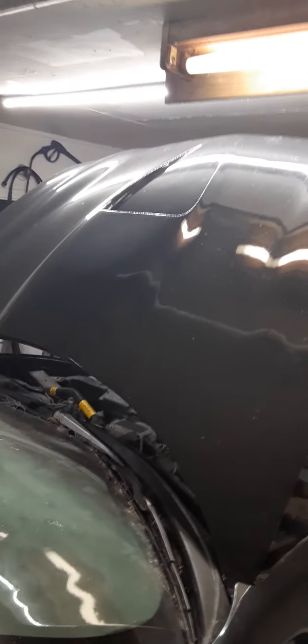I got another rear end to put in it. I think I'm going to put 3.42 gears in — I had 3.73s in my other one which I really liked — but I'm on the edge between 3.42 and just going with 4.10s. I'm not really looking for top speed anymore, it's more about quickness. Plus there's so much sketchy stuff that can happen with such an old car going 140-150 mph. If you get into a crash you're definitely dead — the doors are paper thin, it's like being in an aluminum pop can.